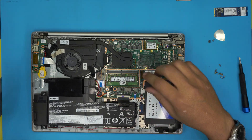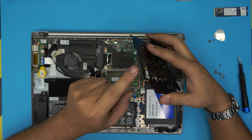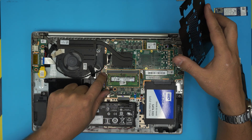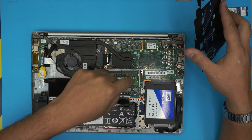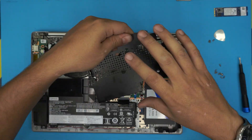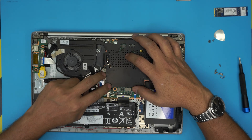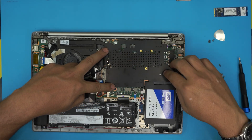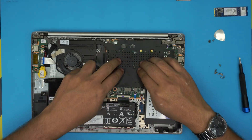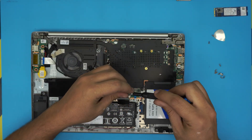Once you have the RAM installed, make sure you put the battery back in if you unplugged it. Now grab the shielding — these corners are going to catch the tiny clips. There are four clips on the sides and a fifth one there, so make sure you align it straight over those clips. Align the corner, align the side, and the rest should automatically go into place. Push in the corner, don't press on the middle — there's nothing to press there — and then put back the three screws you removed from the shield.